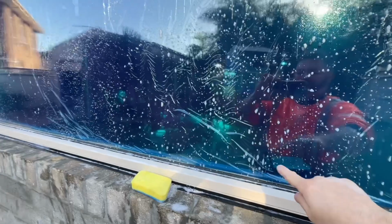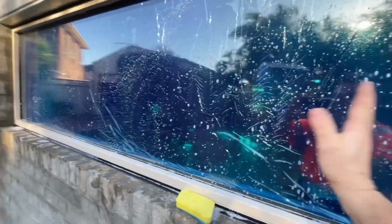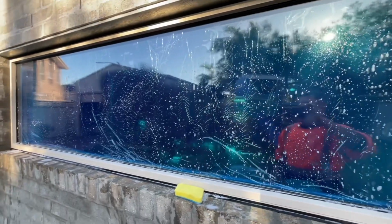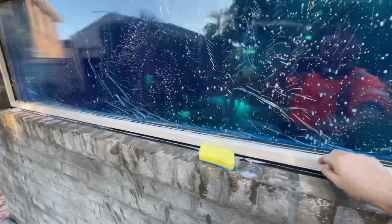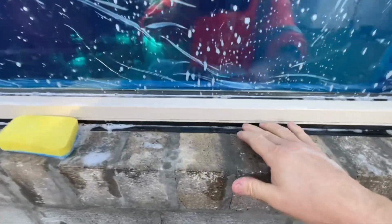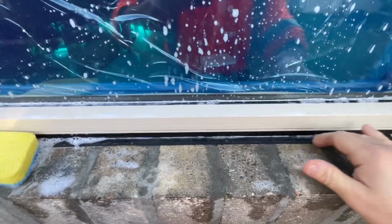I'm going to mask up the window like I did the inside. I don't know if you can see, there's a blue tinge. I've got this blue wrap on the inside of the window to stop any paint getting on there. But I'll do the same. I'll blue wrap it, and then I'll mask up the aluminium, and I'll try and come down onto this rubber, because I don't want paint getting onto that rubber either.